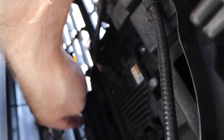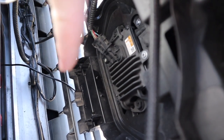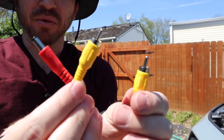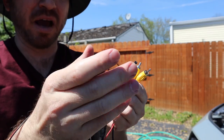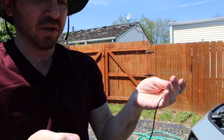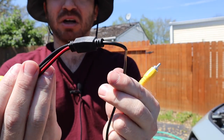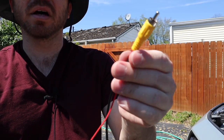The sensor is up here, so the camera is well out of the way and I have nothing to worry about. The wires are brought back — the extension cable is really long, so we'll have enough length to go from the camera all the way through the firewall into the dash. Both tips are unfortunately large, so we cannot go through the firewall through the open nipple. We have to pinch it between the grommet and the frame of the RAV4. Since one side only has one connector and the other side has two plus a large one, we'll start from outside the vehicle and push it in with just the single connector — it'll be a lot easier that way.